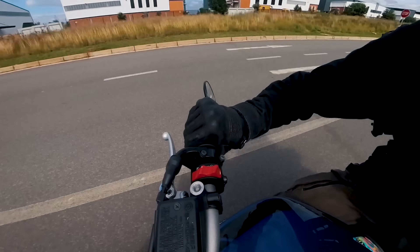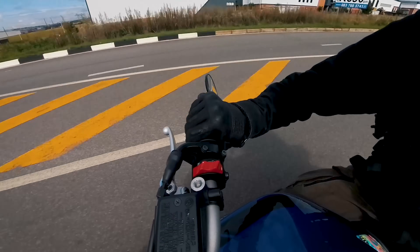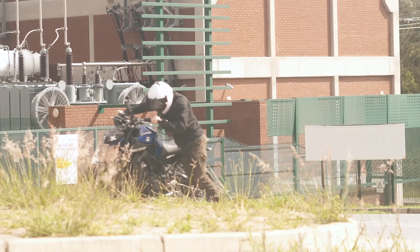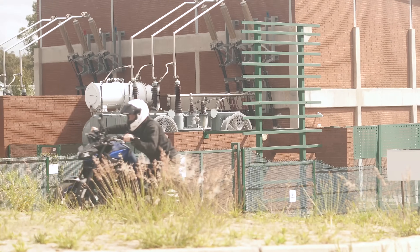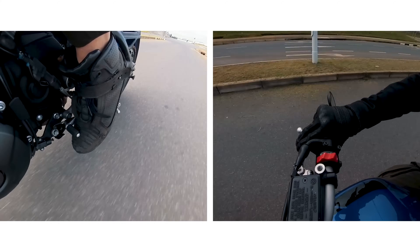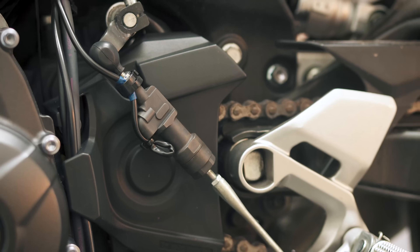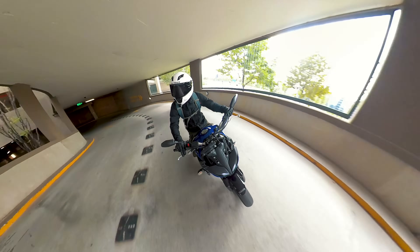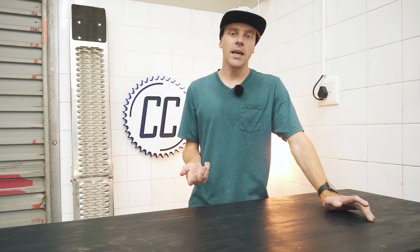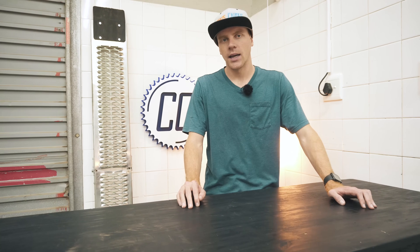If done fast enough, your hand movement is barely perceptible. There might also be a day when some cheeky clutchless shifts are what help you limp home after your clutch cable snaps. So it's never bad to learn a new skill, even if quickshifters and autoblippers are trying to get rid of all our biker skills. Share this video with a mate who needs to learn to clutchless shift, subscribe to learn more biker jargon, and I'll see you on the next ride.